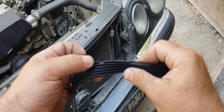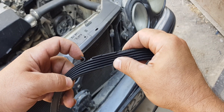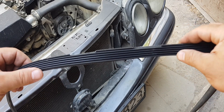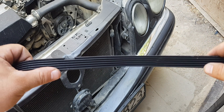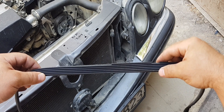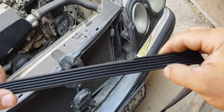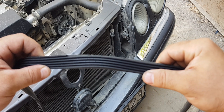There is usually no strict regulation for the timing of accessory drive belt replacement. The working life of the alternator belt is usually about 50,000–60,000 kilometers. Car manufacturers recommend checking its condition every 10,000 kilometers or every six months. The need to replace the drive can also be indicated by a decrease in generator performance if a suitable sensor is available, and by specific sounds under the hood, especially when starting the engine or increasing speed.